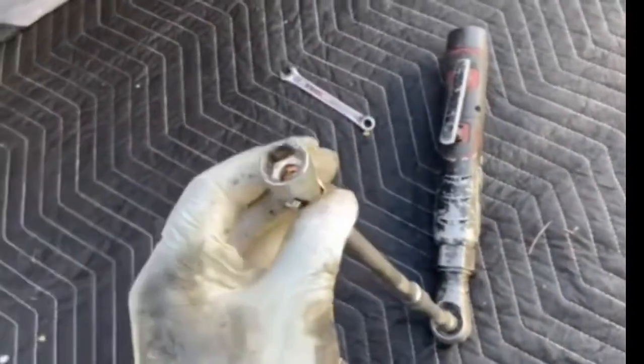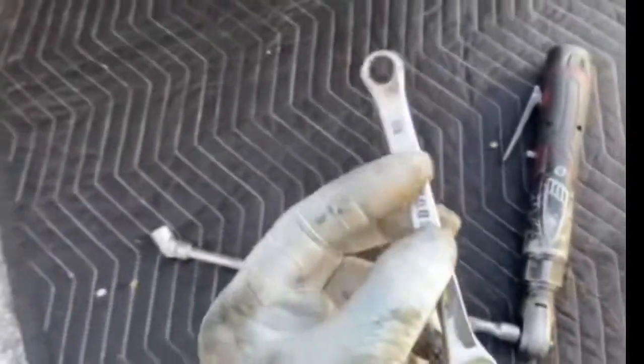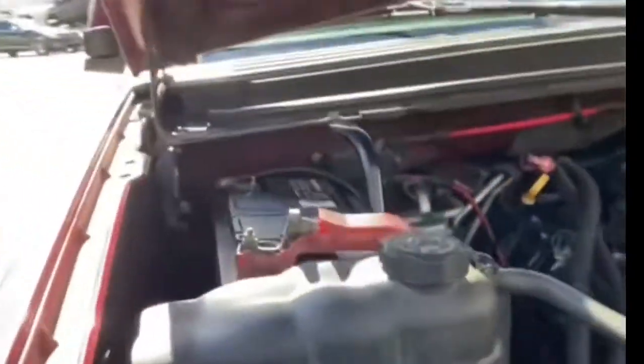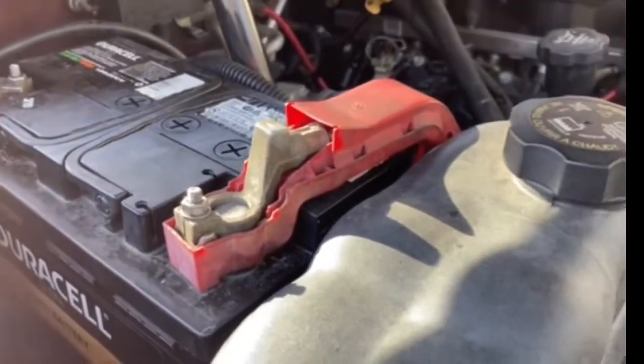Here's the key — you have to loosen up all your bolts. The tools you're gonna need: a Cornwell's air ratchet, three-eighths, or a manual ratchet. This is a 15 millimeter. You're gonna need a 10 millimeter — make sure you disconnect your battery with the 10 millimeter. You're also gonna need a 10 millimeter swivel socket. You're gonna need a Phillips head screwdriver. Disconnect that battery before you get started on anything so you have no arcing.